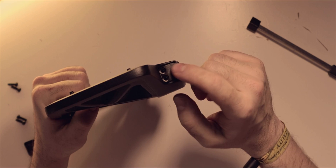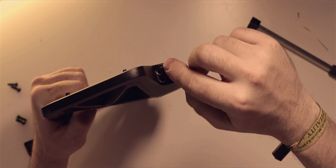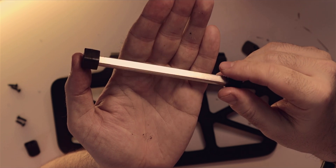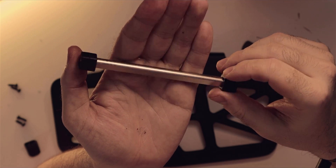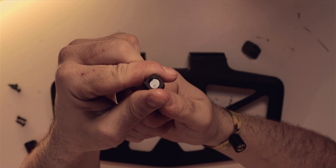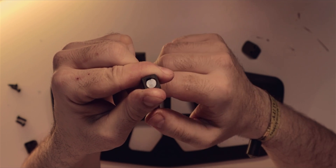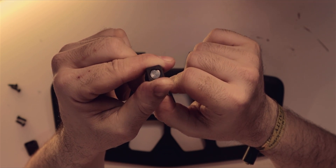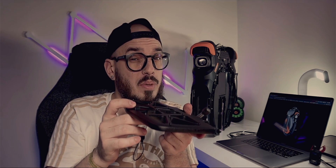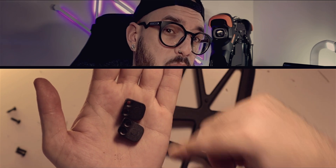This bit is the same material as the rest of the pedal — pure metal — that you'll screw with two screws so they will not come off. These two pieces of rubber are here not only to reduce dust but to add functionality. The axle is not completely round; one of the faces is like a straight line. When you close the pedal the rubber sits in position, but when you open it the axle moves, the rubber stays in place, and the pedal has a tendency to go back to its original shape — basically the pedals will always tend to close by themselves.